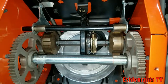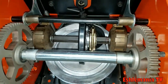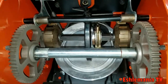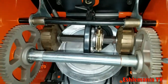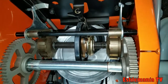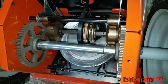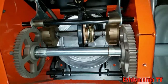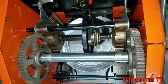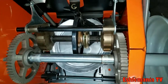What happens here is the friction disc is being spun, and at either end of that shaft the friction disc is on, there are two planetary gears. Those are held by the arms above them. When the triggers are squeezed, it lifts one of those arms, which allows the entire planetary gear to spin, which in turn allows the wheel on that side to freewheel. Since it has no power, the opposite side wheel is the dominant side and just pushes the snowblower in that direction. Pretty simple — we'll give you a better view here in just a second, but this is the basics of how it works.